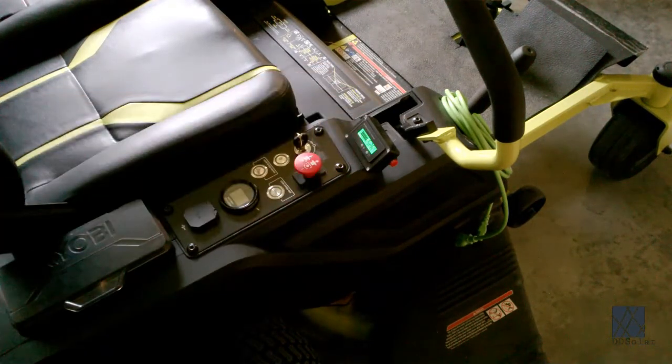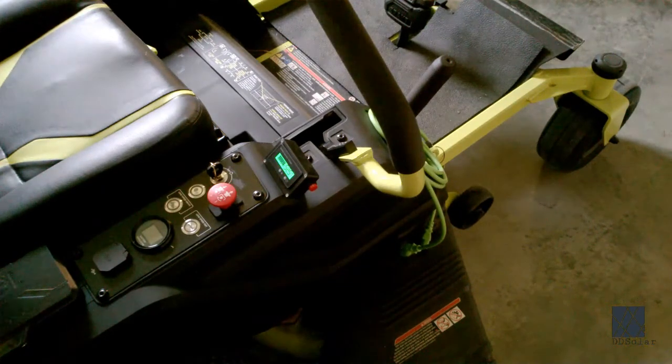The green cable hanging there has been there since last year — it's a new charge cable I purchased for this mower but haven't installed yet. I picked the green color on purpose. Eventually that cable will connect the mower to the boost solar charge controller. The current cable is rather thin, but this is a much thicker cable, so it should help in charging the battery. Currently the mower has a 16-cell lithium iron phosphate battery, and I'd like to add more capacity and perhaps better instrumentation than just a voltmeter.